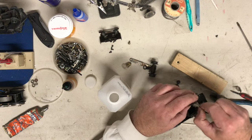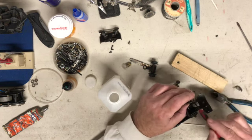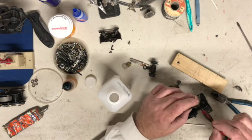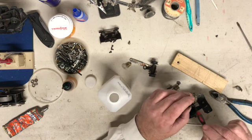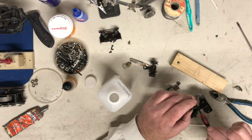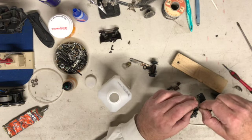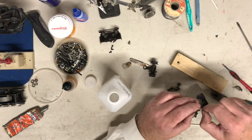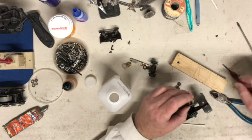Like I said, I'm not too worried about the blue plastic being dirty or black. It's the copper. You can see right here, it's hard to see, but right here something melted this. Something melted that plastic, so there's a little bit of a bump there now, so when this goes around and hits these fingers, see that finger's starting to hit it right now. If you can see that, there's another little melted spot. So really, this should probably get a new drum. This is definitely a customer for a new drum, because I think the fingers and everything else are okay, but I think the drum is just, for some reason, something had shorted out in its lifetime when the fingers were turning, and see, there's that spot.